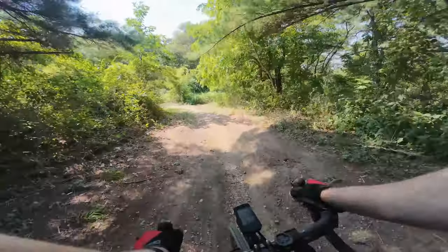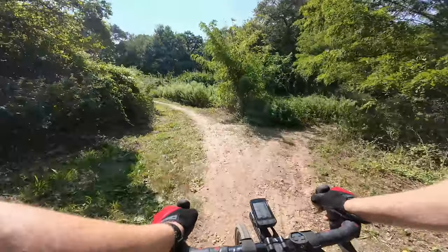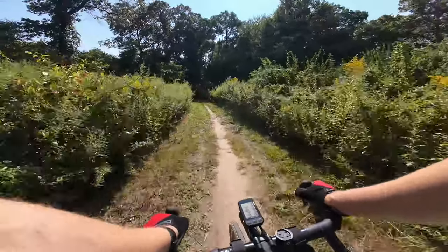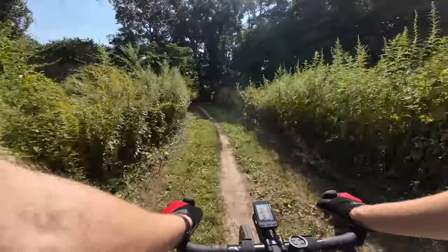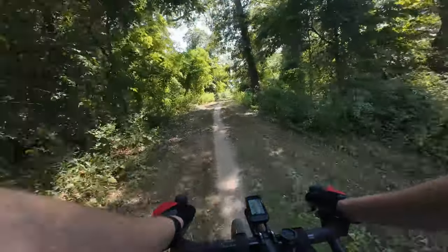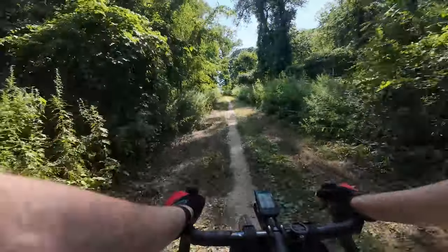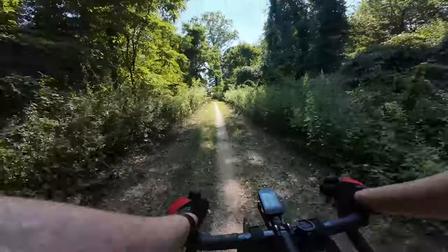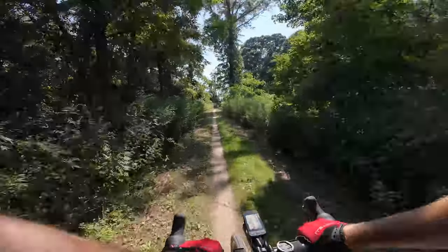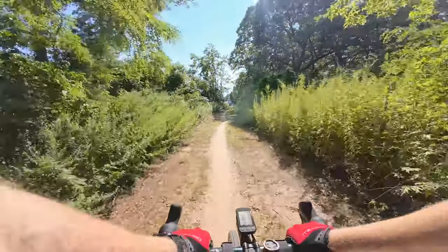You need disc? Yeah, sure. Who knows anymore? Rim brake, disc brake, whatever you choose. Rim brake's definitely simpler, cheaper to operate, but you gotta clean your rims and clean your brake pads a lot. Disc brakes, more set it and forget it. Wider tires, once in a while straighten a bent rotor, and that's pretty much it.